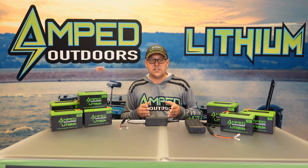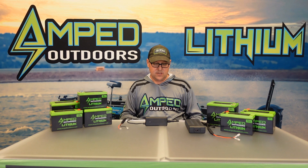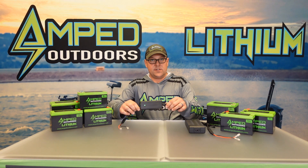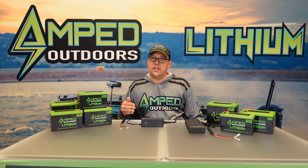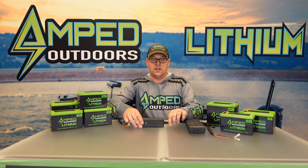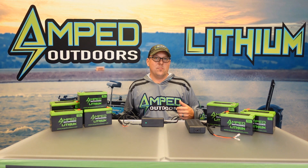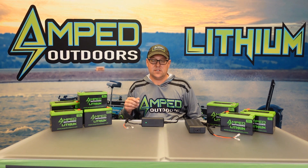The first thing we can do for testing the charger is make sure there's power going to it. Take your AC power cord and connect it directly to the wall — I would not recommend using an extension cord. If it's getting proper power, the light will turn green on the charger. If it's not turning green, make sure your connector is tight in the AC plug and that you have proper AC power from that outlet. It's common that a breaker may have tripped or it's just a bad outlet, so make sure you have a good AC outlet for testing.